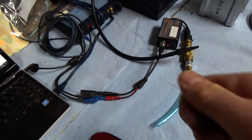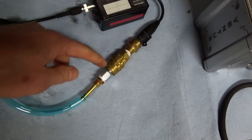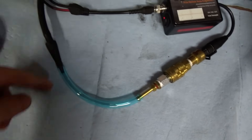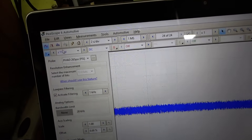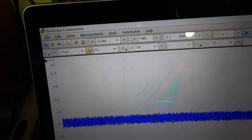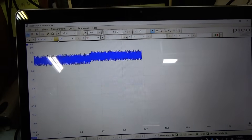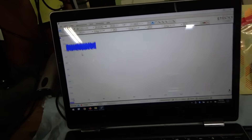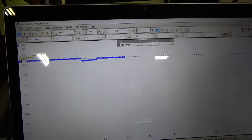Now let's plug this into my pressure transducer to see how many PSI it puts out when you turn the flow on. The pressure transducer is on — this is the 265 PSI unit with the included adapter. On PicoScope 6 we set up the scale, choose the 265 PSI probe preset, plus or minus 15 PSI. After turning it on and dropping the scale to minus 16 to 4, there's not much pressure at all — about 1 PSI. So we're done testing the OTC Leak Tamer.